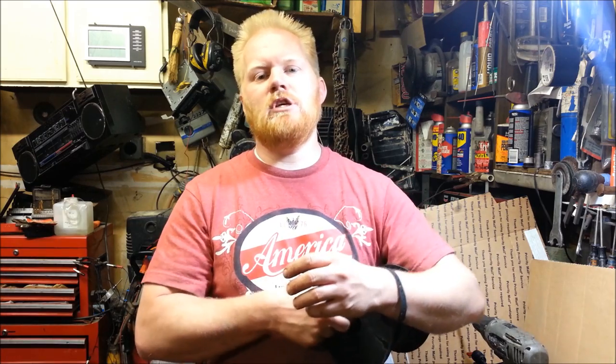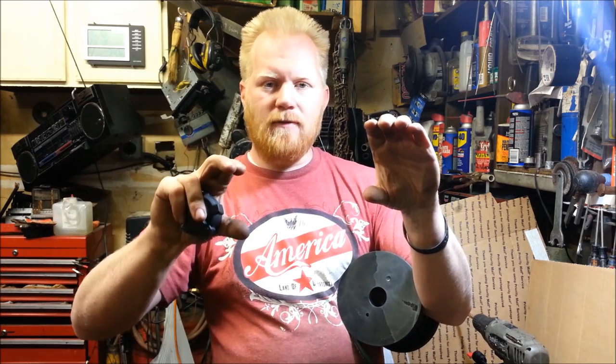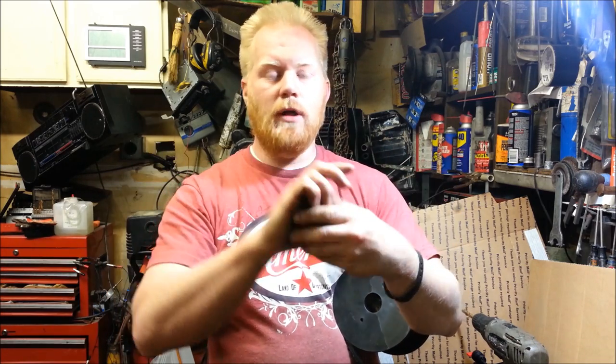The Honda EU-2000s and the EU-1000s both have a fuel pump inside. Most engines are gravity-fed in lawnmowers — the gas tank is higher than the carb, so gas is just fed down. But to get more capacity, some of the gas tank sits lower, so they actually had to put in a fuel pump. That's our benefit, because it allows us to suck more fuel in there.